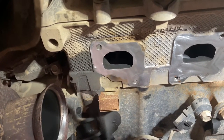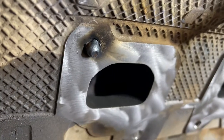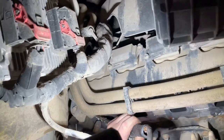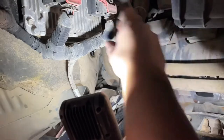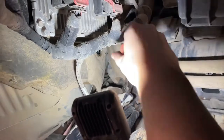I'm going to go ahead and start welding that up and show you how it's done. First I tack weld a little bump onto the stud so I can slip a generic nut over it, then weld to that and unthread it. Now I'm going to weld the nut on. I welded the nut on and it's threading out, so we grab a ratchet and socket and thread it the rest of the way out. The heat penetrates and frees up the stud — not too hard to ratchet out.